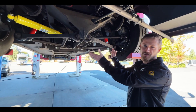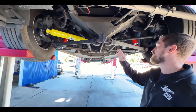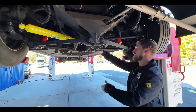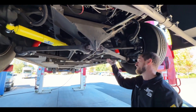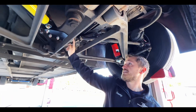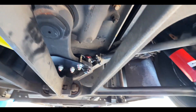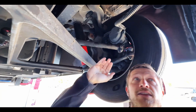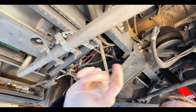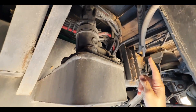The first thing you'll notice looking at the front suspension is that it does have the independent front suspension. This is the ZF independent front suspension, and it's an interesting design where you've actually got the steering gear located in the middle of that front suspension area. So you don't have your typical drag link coming back — instead you've got your pitman arm connecting directly to the steering gear, your tie rods connecting directly to that pitman arm, and then over to your steering arms. Your steering input shaft to the gear comes down here toward the gear, goes up to what's known as a miter box or a 90-degree box, and then goes up to your steering wheel.